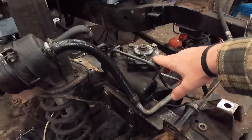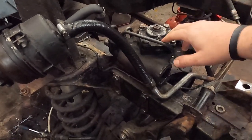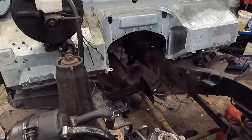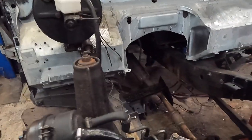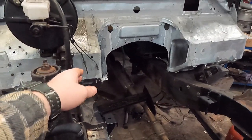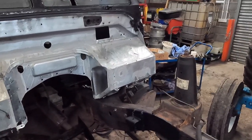Today's first job will be getting the old power steering box off — as I say, it's up to maximum adjustment. We'll bin that, send it back for recon, and put the reconditioned one that's already on the bench onto here. We've got a new box because even after cleaning this one up it's still in absolutely terrible state. Once the steering box is on, we can get all the steering column and everything back in place. Brakes will be on, and we've got the brake bias valve — I'm starting to lean towards this being the whole issue behind all my brake problems. It's never been changed even though the vehicle's been in the garage umpteen times for brakes, so it was probably 33 years old as well.